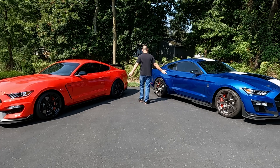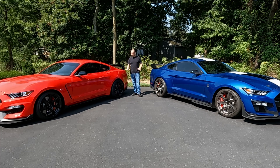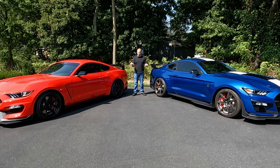Moving to the rear of the car, the overall design is basically the same. The Shelbys are a little bit wider than the standard Mustangs to help incorporate the larger wheels and tires, but the overall shape is basically the same. They put a rock guard on the back of the car, but not on the front — I wish they had done that. I highly recommend to any Shelby owner: put a rock guard on the front wheel — it'll help keep rocks from getting shotgunned down the side of the car and damaging it.